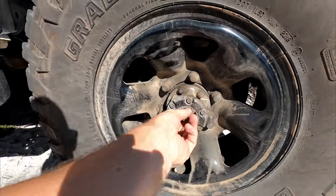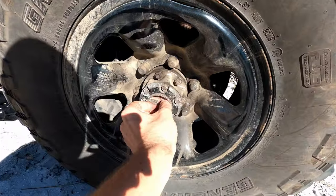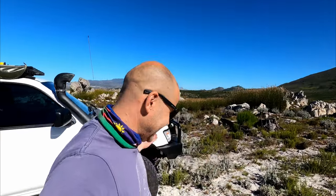Steel versus aluminium rims is a personal choice. For the bush, I prefer steel — you can fix steel in the bush. I'll put a Ronnie Dahl link in the description for an excellent steel vs aluminium video. Then there are the hubs — no greater feeling than switching them on and off when going into 4x4. One important tip: if your vehicle has locking hubs, you need to drive at least 13 kilometers in 4x4 at least once a month to keep the system lubricated, as per the owner's manual. Don't park it for three months and then try to go 4x4 — the hubs can get stuck.